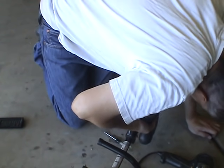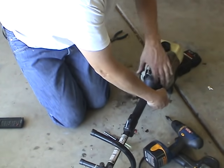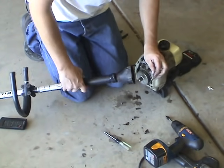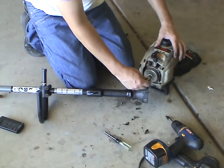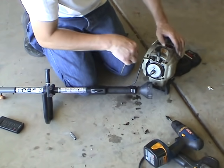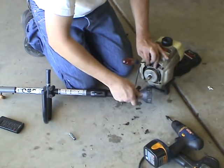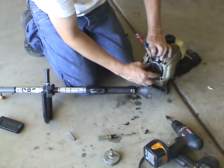There are four of these screws on here. Once the screws are off, you can open this up. There's a spring here — it fits on there. Take this clutch wheel off; you can jam the motor a little bit. Take the screw — this is a Torx bit — unscrew that and take this off. Now this is the clutch weights.